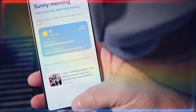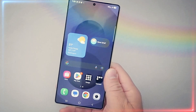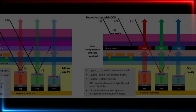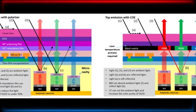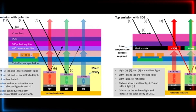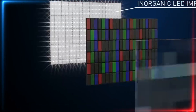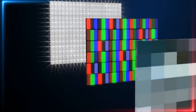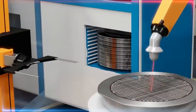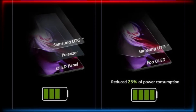This is not the first time we have heard of CFoTFE tech adoption on the Galaxy S26 Ultra. A previous source claimed Samsung wants to apply Color Filter on Thin Film Encapsulation technology to the Galaxy S26 Ultra. CFoTFE substitutes the polarizing plates in OLED with a color filter and converts the general pixel-defined layer to a black one. The polarizer layer in an OLED minimizes reflections and increases visibility, but adds thickness and blocks some emitted light, reducing perceived brightness or requiring more electricity to reach the same brightness level.